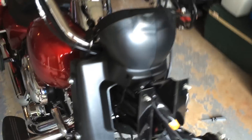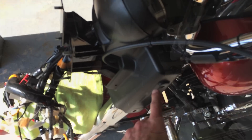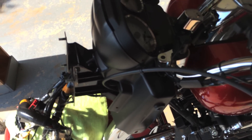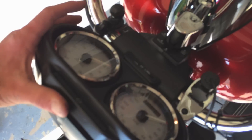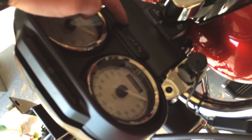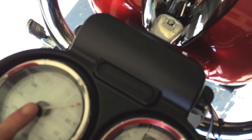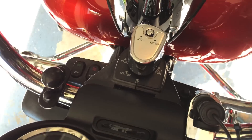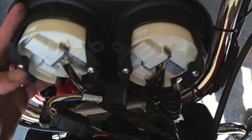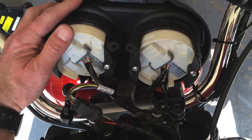Now it's time to take off the inner console plastic pieces. The screws are out here — use the Harley Torx tool that comes with the bike. I'm going to pull out the side ones here. This fits underneath here; if you've ever had it pop out, you're used to it. As you rotate this forward and pull back, you can see the tab where it slips under. So you just pull that up out of that slot. Undo these four Phillips head screws, then unplug the connectors, marking them if necessary if they're not obviously different types of connectors.